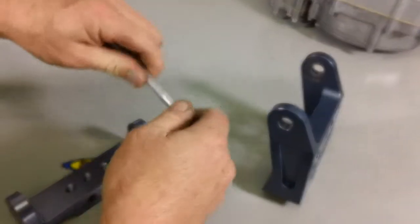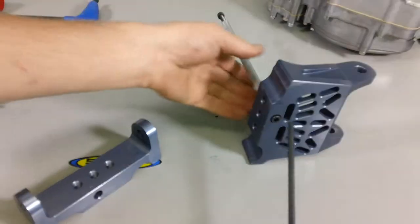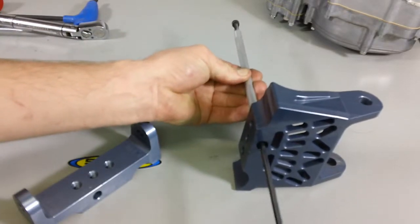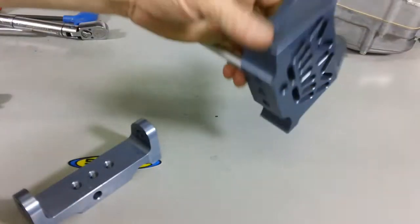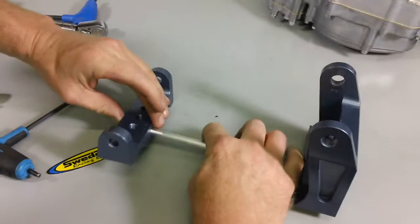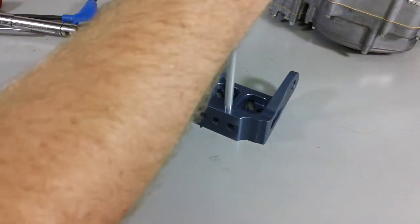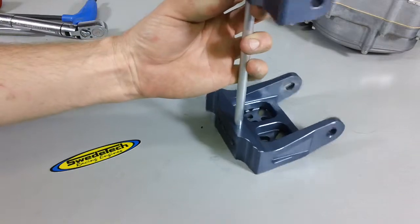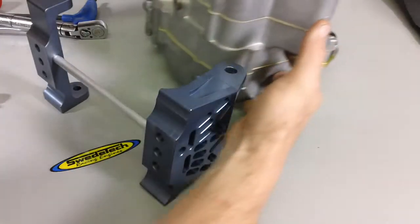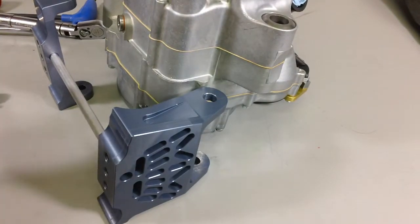Make sure you have all the proper parts. If you haven't already, refer to our other video on making sure the mount fits the frame properly. We're going to tighten the tie bar to the rear support first. You have to tighten this immediately because once it's mounted on the frame, you won't have the option to tighten it. For the front bolt of the tie bar, we're just going to lightly snug it — in fact, we're going to lightly snug all the hardware. This allows the mount to take form of the chassis and keeps the engine free, avoiding a pre-bind.